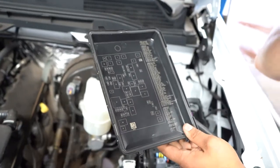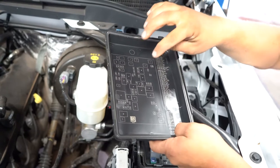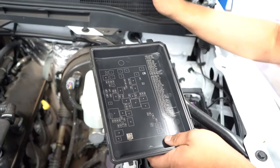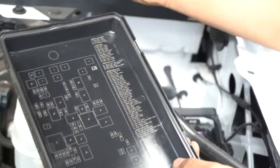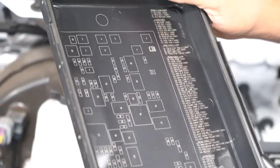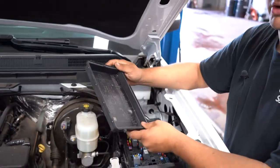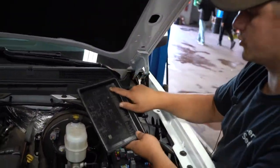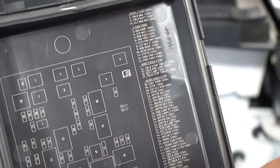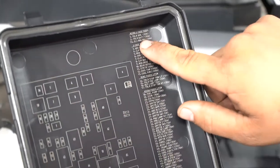When you're looking in here, you're not just looking at all the fuses — you're going here to look for something specific. Let's say you hook up your trailer and your park lights aren't working. You'd check your connection, and if that didn't work, maybe check your fuses. It's common for trailers with old wiring, in and out of water, to blow fuses. You scroll through the list and it'll have an abbreviated description of the main thing that fuse runs.